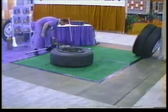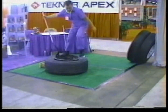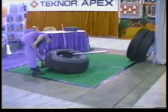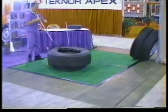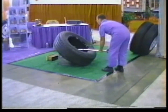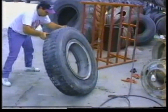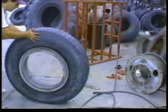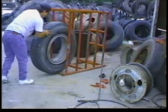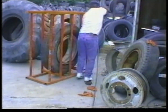Install the demount tool in the same manner as any other tubeless truck tire. Demount the top bead. Put the seven-inch high block under the sidewall and continue the demount process. Remounting of super singles is just like regular truck tire mounting with the mount tool. After any truck tire remount process, OSHA regulations require that all tires and rims be put into an approved tire inflation safety cage for inflation. Use a clip-on air chuck and stand away from the cage.